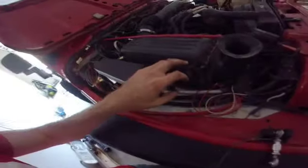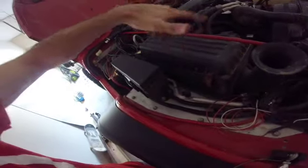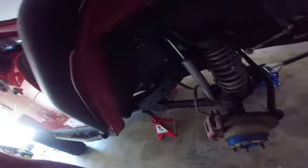And on the passenger side, if you have the stock fenders, you're probably going to have to open up. So unscrew this worm clamp, take this off, and open up the airbox. There will be 3 8mm, and you can take the airbox off and reach it from the top. But for me, with the metal fenders, I can just get at it right here. Again, a 9/16 to get the top off on the passenger side for the shock.